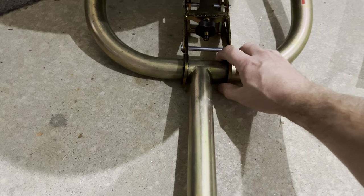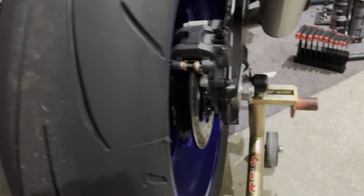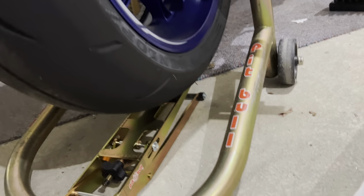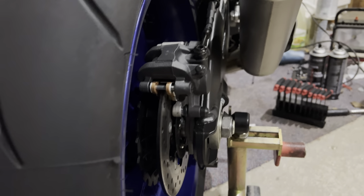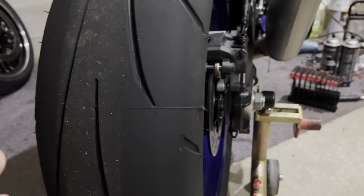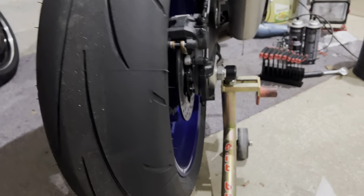What this does: if you've taken a wheel off, you know the biggest problem is getting the rear tire off — trying to hold everything. You loosen the axle nut, slide the axle out, and then it's a juggling act. You're trying to hold the wheel steady with one hand so it doesn't flop around, remove the caliper, deal with spacers. Getting the wheel off isn't too bad, but getting it back on with two hands — you're trying to lift the wheel up over a big gap, hold it, slide it in, get the chain over the sprockets, not knock loose the spacers while getting the disc in the caliper without knocking the caliper off. You literally have five or six moving parts while holding a 30-pound wheel, trying to line it all up with one hand and then slide the axle through to lock everything. Depending on the bike, it can be a major pain.